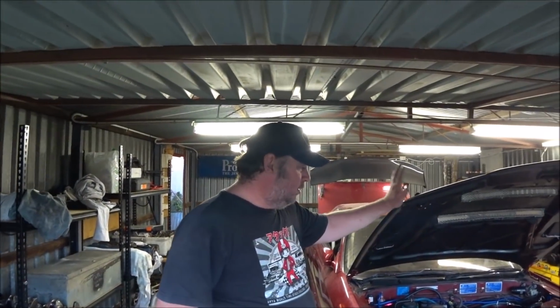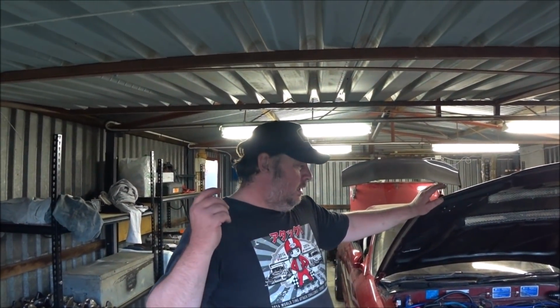So real quick, the last video I said it's got low compression. What I'm hoping it is, because I'd left the lifters soaking in oil for so long, they over pumped when I was trying to start the car, and it's just holding the valves open ever so slightly. The compression numbers were 65 psi, dead even across the board. If it's not that, I don't know what it is. Other things it could be, if I managed to install every ring incorrectly but exactly the same incorrectly to allow the exact same compression on every cylinder.